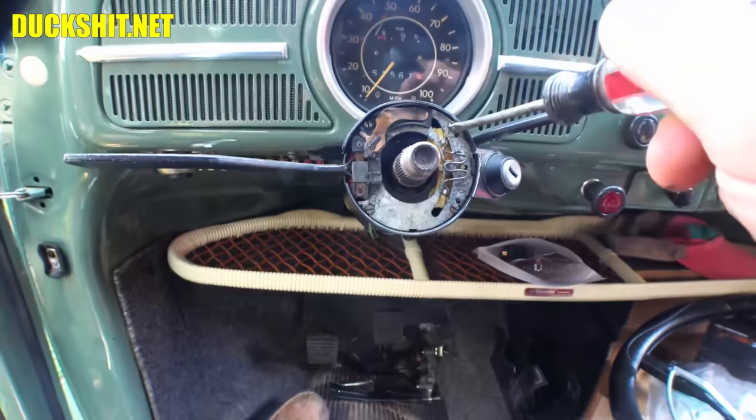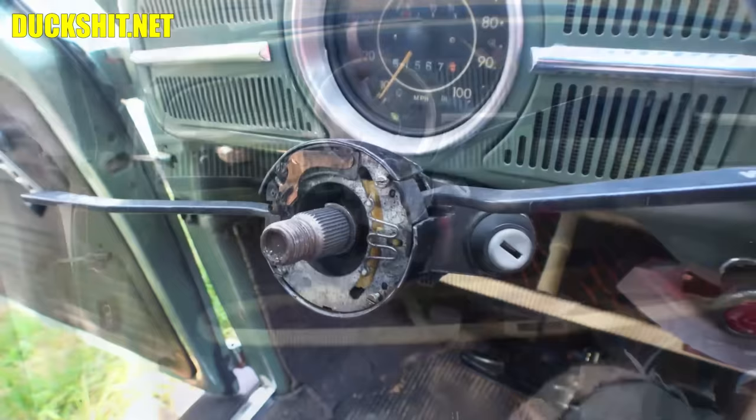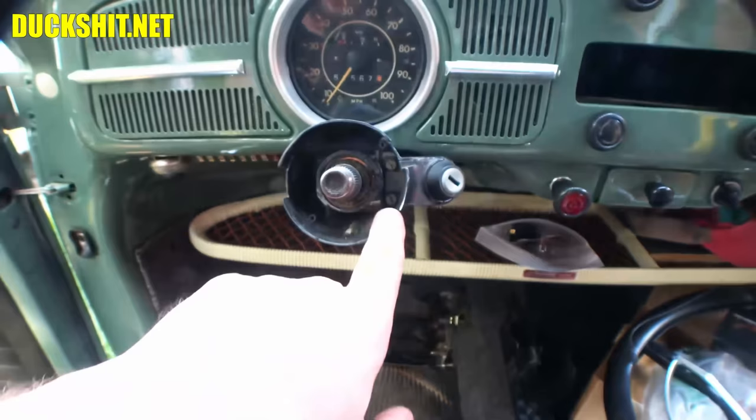Very often on these cars there aren't four remaining, or sometimes one or multiple of them is broken. I've even seen some cars where there's none. It doesn't help the switch cluster because the whole thing gets all floppy inside the steering column. Each one of these four screws has to come out. Before we pull it apart, let's disconnect the harness from it. That wasn't even plugged in all the way, which could have been part of our problem as well. I got all these screws loosened so they're all out, so the whole switch cluster should pull straight up. Sometimes there are hoses on these for the windshield squirter, but on most cars they've already been removed — this is one such car.